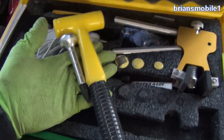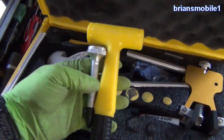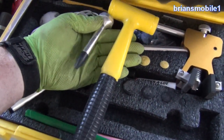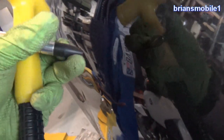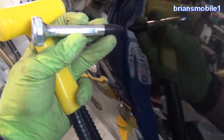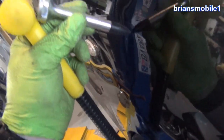As part of this job, anywhere there's a high spot you've got to be able to take that back down. Just like math — addition and subtraction, one does something and the other undoes it. If you get too far and have something standing up, this takes it back down. Using a soft tip chisel or drift with a plastic hammer, you just tap in a little circle around the high spot and bring it back down — same as a dent: start on the outside and work to the middle to get it back flat.